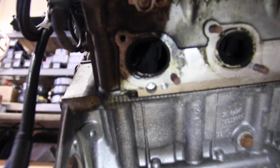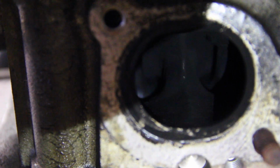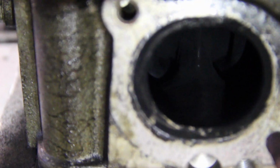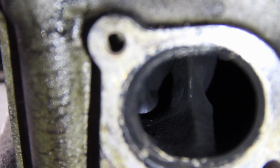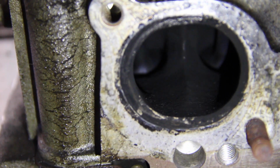As we attempt to focus and look inside at the exhaust valves where the manifold would connect, it's very black in there, but there are no large clumps of carbon like I honestly expected to see. It's not that bad. This engine was removed from the car in 2008, disassembled, and carbon cleaned. So maybe that's why it's only had around 84,000-86,000 miles since all that was done in 2008. It's dirty in there, but not enough that it would affect performance or economy all that much, in my opinion.